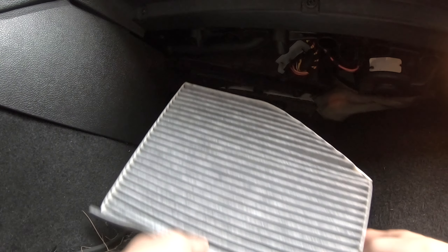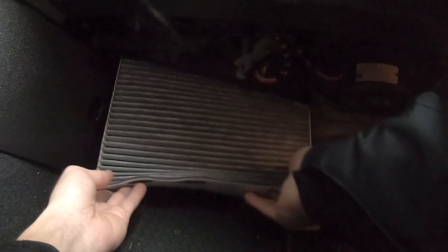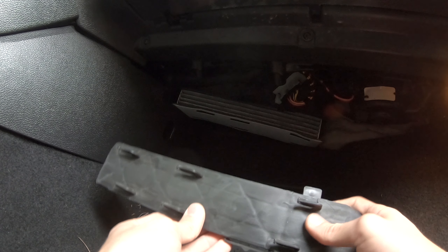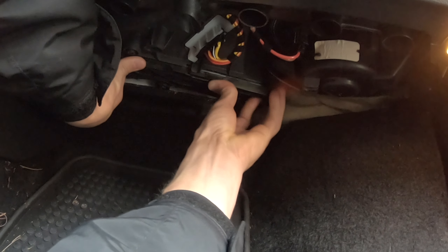There's only one orientation of the cabin air filter, and that's in this orientation right here — the same way it was when you took the old cabin air filter out. Grab this piece and let the hooks point to the left side because you're going to slide it in, just like that. After you're done, make sure that it's not moving around. It should be very firm and set in place — that's how you know all the hooks have hooked up into their proper place and it's sealed tight.